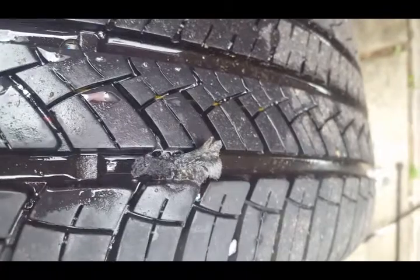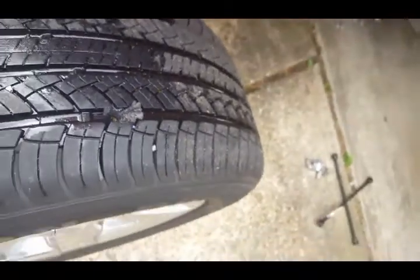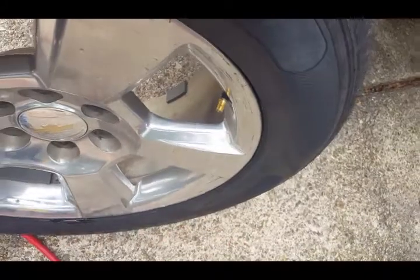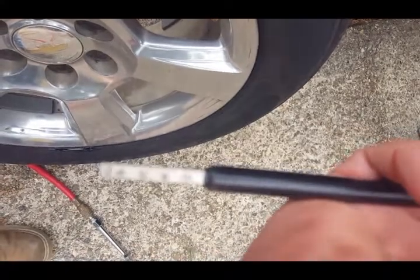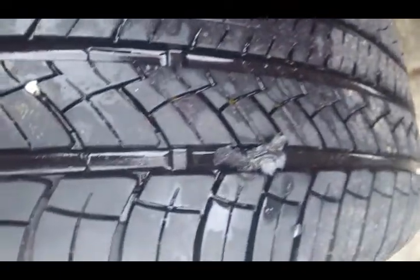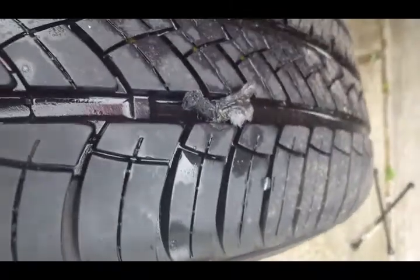What I'm gonna do is pump it up with air and see if it's gonna leak, then go from there. I just got my air pump and aired it up to 50 PSI — right at 50. There's my plug — that's what it looks like up close. Now we're gonna put some soapy water on it with the air pumped up to make sure it's not going to leak.